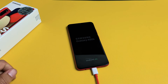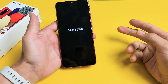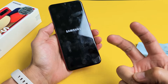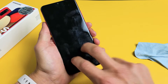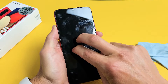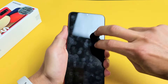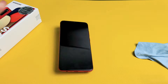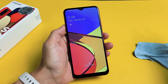If not, we're going to go to the third possible step. Go ahead and unplug your phone. What we're going to do is what I call the tap method — because you're going to tap the phone. We're going to tap the screen all over as well as the back. Grab your phone and just use two fingers. Tap it kind of hard all over. A lot of times when you're doing this, all of a sudden half of your screen might come on, or the bottom half — you might see white lines, or sometimes it just pops on. Basically, something is dislodged and you're trying to put it back in place. A lot of times if you drop your phone you'll get the black screen, or sometimes you'll have it charging one night and the screen just doesn't come on even though the phone is on.